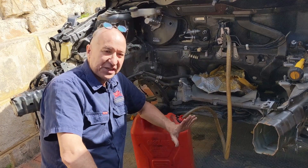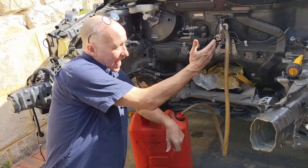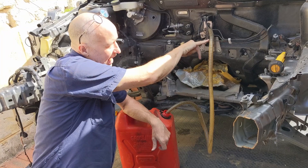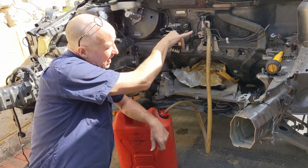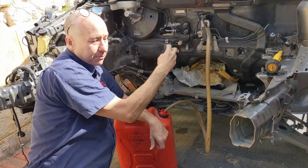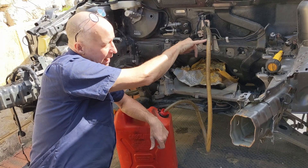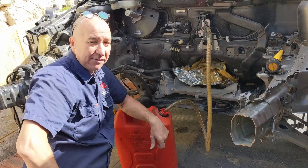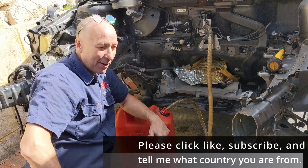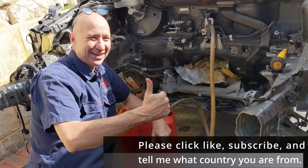So this is the end of the video. That's another way to get fuel out of a fuel tank — you can obviously do it when the engine is in the engine bay. You just have to remember that that is the line from the tank, while this line here is the return line back to the tank. So when you're putting 12 volts across the fuel pump, it will pump fuel out of that line, not that line. I hope that's helped you. Please click like, click subscribe, leave me a comment, share some love and share some knowledge. Thanks from Paul in Perth. See you later.